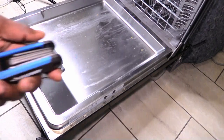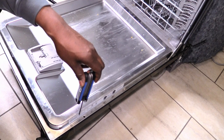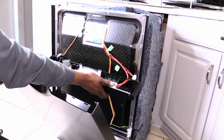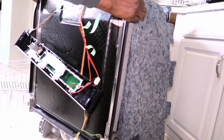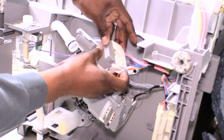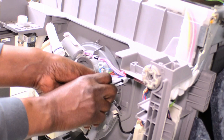Find the right size on your star screwdriver that fits the dishwasher door, then remove all of the screws around the border of the door. Here's a tip: you may want to use gloves when removing the door so that it doesn't cut your fingers. Also, be careful to make sure the door does not fall. Now gently turn the dishwasher on its back. Twist the drain pump clockwise to remove it. Then grab your Torx or star screwdriver and remove the two plastic braces that are holding the sump to the base of the dishwasher.